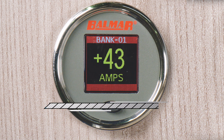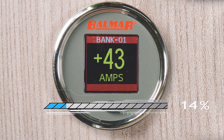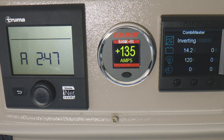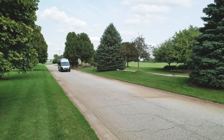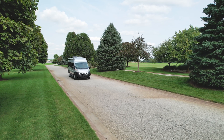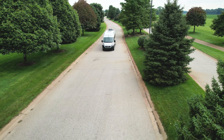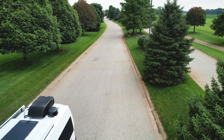As you watch this gauge, take note that a battery at a lower state of charge will charge fast, and that charge rate is going to decrease as the battery level increases. This is totally normal. The charging amperage rises with increased RPMs, which means driving the vehicle will increase the charging current, reducing the amount of time needed to bring the batteries to full capacity — so in short, go for a drive.